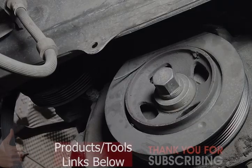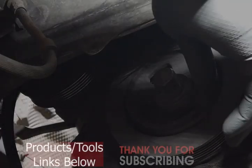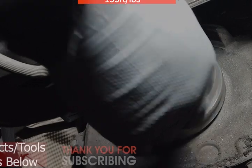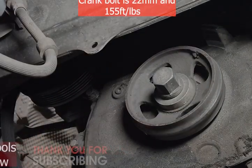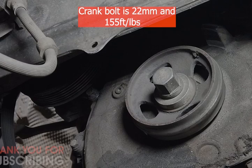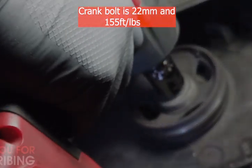All right, taking a look at this. This is blowing my mind. This is just completely, the dampener is completely gone. I mean, there's nothing there. There's no rubber left. So I guess just the tension of the belt was holding it in place. That's a bad situation to be in, based on the fact that that'd leave you stranded about anywhere you went. I don't even know if I can get this off now.